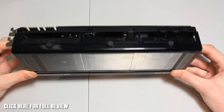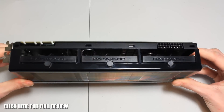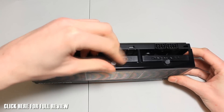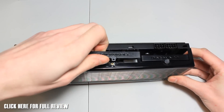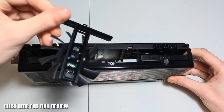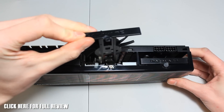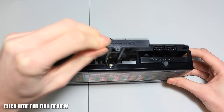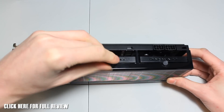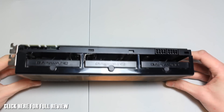There's a very special feature on this I want to show you. The fans are on the inside - you can see them in there - but if you wanted to clean it, what do you do? They've thought of this, and this is just genius. You unscrew one of these little tops and you can actually remove the cooling fans completely. They've got a connection on the bottom that looks very similar to a floppy connector - they literally slide down and in, then you screw them back in. Being able to clean your fans that easily is a pretty big revolution in cooling.